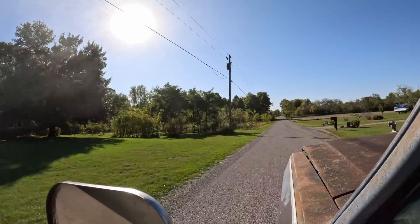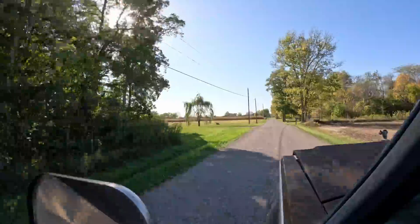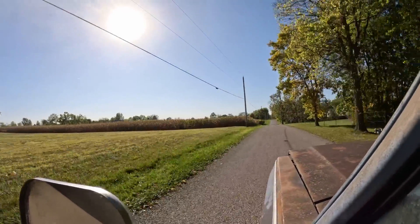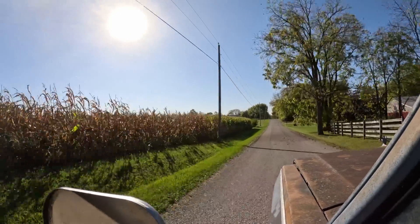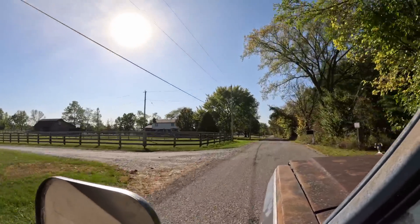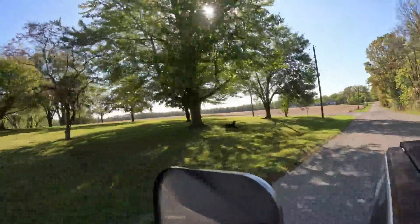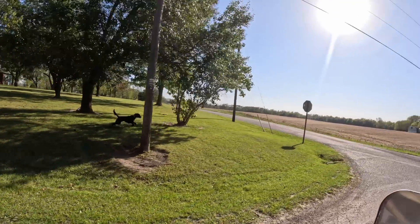The timing's advanced too much — I can hear just a little bit of spark knock. We're going to have to hit it with the timing light, but that's the least of our worries. It's actually riding pretty good — up to about 40 mph I'd say. I'll slow down because of the tires and the brakes, but the brakes are coming back around and starting to feel a lot better. Getting a lot more pedal now. I think we could have made it all the way around the block. The engine and transmission sound real good.